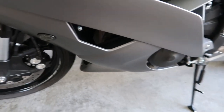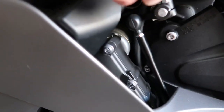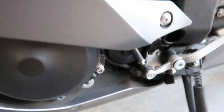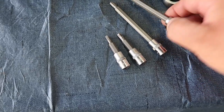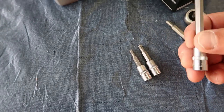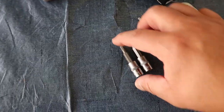We've got to remove this fairing here and this fairing. We're going to need a 10mm right here to take this off to get to the oil filter, because the oil filter is down here. I'm using a quarter inch ratchet. You're going to need a long extension — one of 5/32nds and a shorty 5/32nds — and I'm using a 3/16th and a 3/16th shorty.